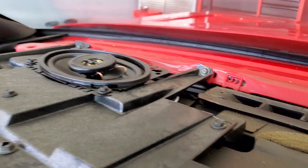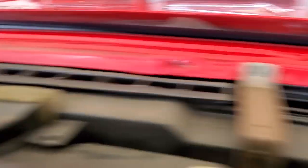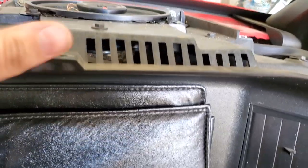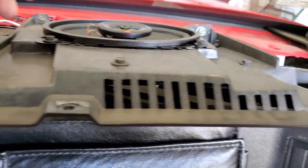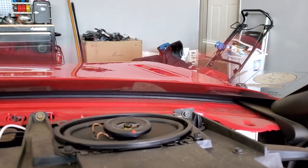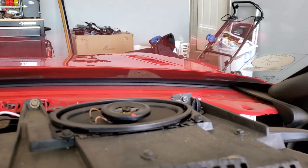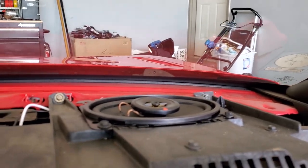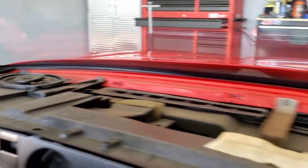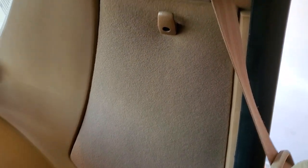Both are back in and they seem to fit just fine. They do only have the two screws holding them in so they come up a little bit in the back, but I don't think that's gonna be a problem. One thing I will say: be very careful not to hit your windshield as you're pulling out the speakers because you won't want some silly crack. I did tap it a couple of times — it's glass, it's fine — but be careful. We're gonna put the dash back in and then move on to the ones back here, which should only require removing that panel and should be pretty easy.